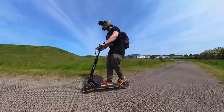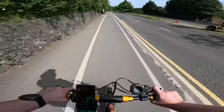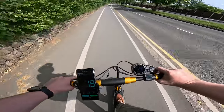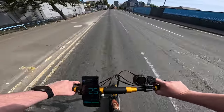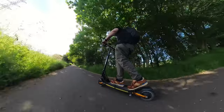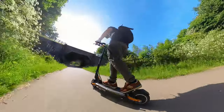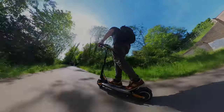Back to the range test — we've not been taking it easy on the throttle, and that theme continues throughout the rest of the ride too. I even took a few gravel tracks, which probably aren't that easy on the battery either. I mainly stuck to bike paths and averaged around 16-20 mph for most of the trip, but there were a few on-road sections that I couldn't resist opening the throttle on. We ended the ride at 15.2 miles, and after sitting for a second, the battery recovered to 45 volts, or about 20% remaining capacity. I'm confident that I could squeeze an extra 4 or 5 miles out of it, which means it'll do 20 miles with a heavy rider in mode 3 with dual motor. If you ride in eco and ride sensibly, you'll be able to go much further, but that's not why you buy a scooter like this.